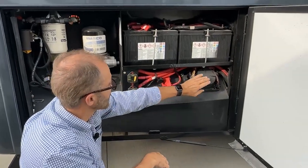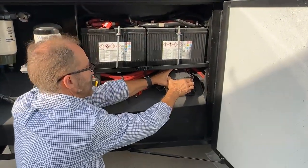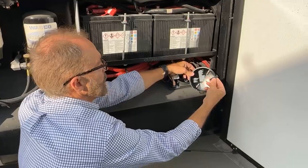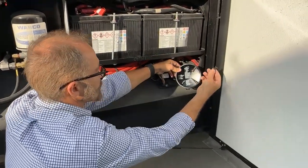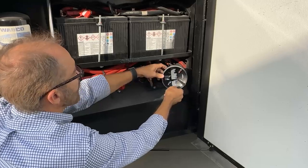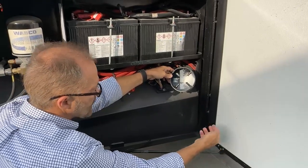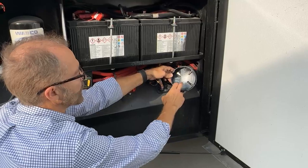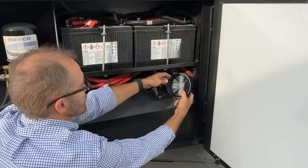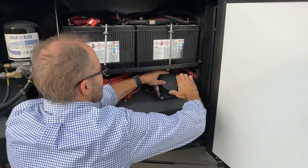Just to the right of our breaker is additional fuses. We can rotate this counterclockwise and remove it. We can see we have spare fuses here and a tool you can use to take a fuse out, check it, and make sure it's good. All the fuses and relays are labeled with the position — so for instance, if you were not getting any marker lights in your tow vehicle, those lights are all fused here. Check your fuses in this position. After checking or replacing, just put the cap back on and rotate to the right to lock in place.